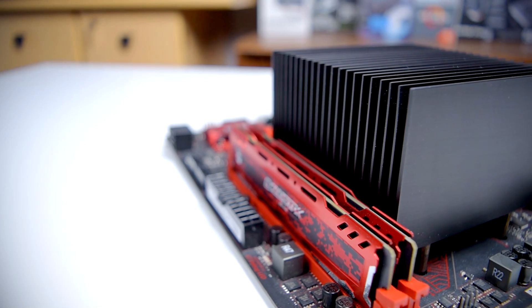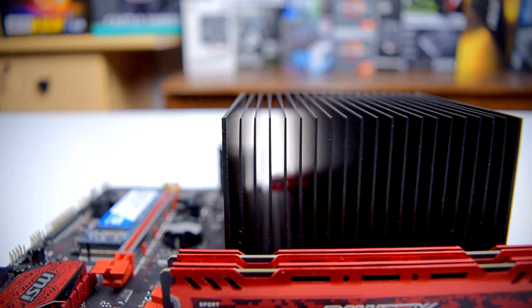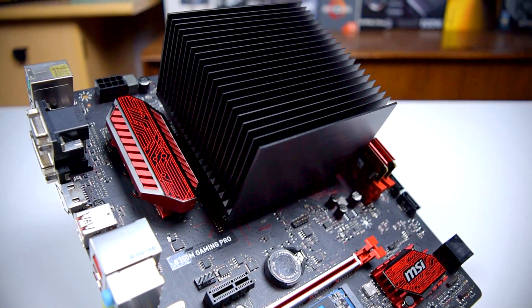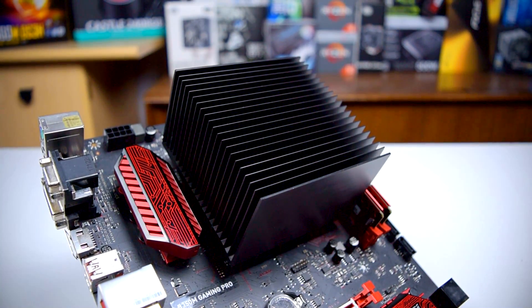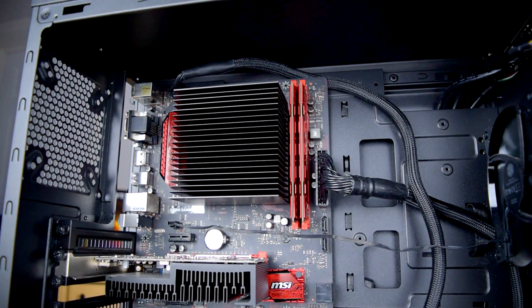The installation procedure for the Alpine AM4 was a bit finicky, mostly because you have to try to line up the patch of thermal paste on the cooler with the CPU. To be completely fair though, it is a really straightforward process and only takes a few minutes, and unless you're switching out coolers every week like I am, you'll probably only have to do it once. The big thing to keep in mind is that I was using a Ryzen 3 1200 to really push it to its limits — the 1200 is among the first generation of Ryzen processors, which are quite a bit hotter than the second gen. The 2200G and 2400G would be a better match for this cooler in the real world. Actually, I think this cooler would be perfect for a home office build with AMD's 2 core 4 thread Athlon 200GE, which has a TDP of only 35 watts — that won't get anywhere near its thermal limit. You could very readily make a completely silent office PC if you only utilize SSDs, a semi-passive or completely passive power supply, and a passively cooled graphics card. And to top it off, the Alpine AM4 is under 15 bucks — really, really cheap.